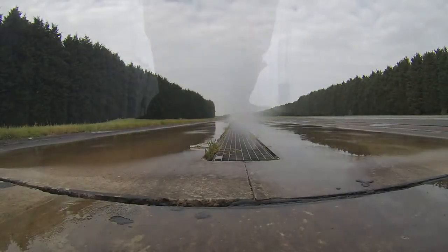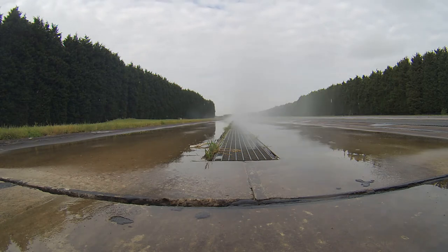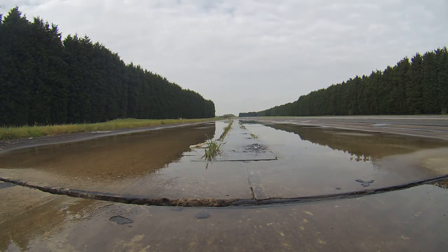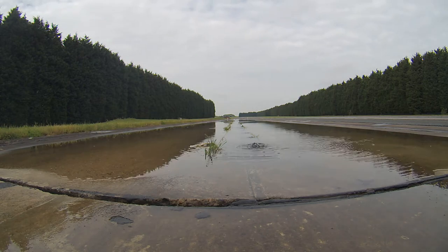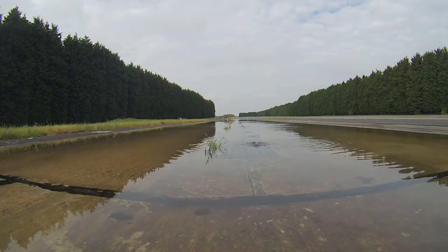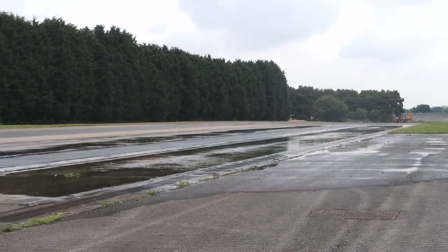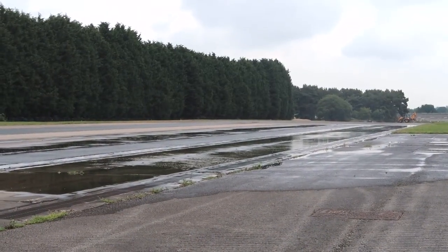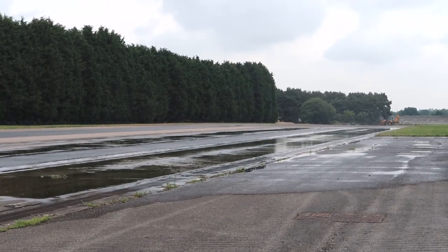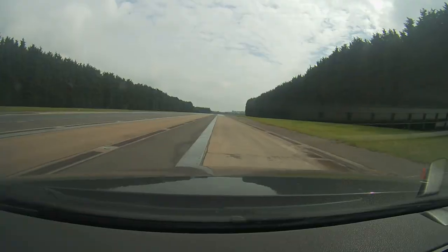Okay, that's the glass plate done. Let's go and do some aquaplaning. The aquaplaning trough here at MIRA can be filled to around 10 millimeters water depth. It's a lot of water, but it's essential to test for a tread pattern's resistance to aquaplaning. This is one of those tests which also needs to be done on a fairly wind-free day, because the water can pool at one end or the other, certainly if the wind is blowing longitudinally in line with the trough.